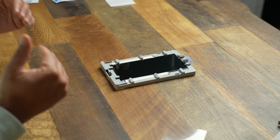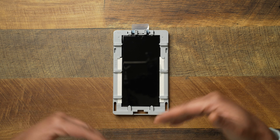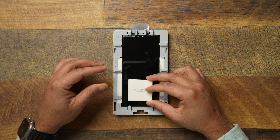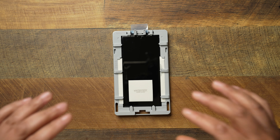We're finally back — the glue has all settled. Don't worry if it doesn't seem to reach the bottom right away; you can lift it a tad to assist because the bottom piece takes the longest. Next, grab the little weighted piece of rubber — Whitestone Dome added this to help the fingerprint scanner work better with the screen protector on. Set it on the fingerprint scanner area for 30 seconds. That ensures that area is pressed in the most so the glue can disperse properly around the scanner for better accuracy. After 30 seconds, carefully remove it and set it to the side.